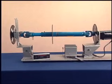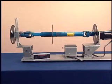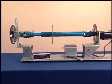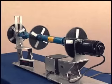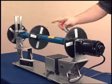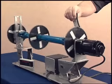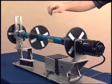When there is no operating angle on the U-joint, the output yoke of the driven member, the U-joint, and the driveshaft all travel together at a constant speed. Watch the tape on these sprockets and listen to the sound the card makes as the driveshaft rotates at the same speed as the output yoke and U-joint.